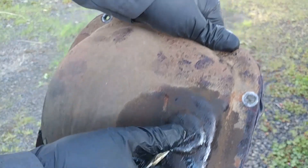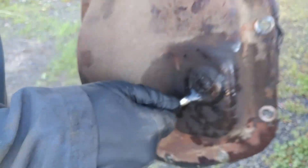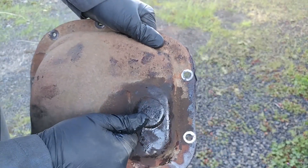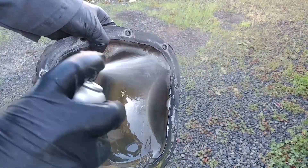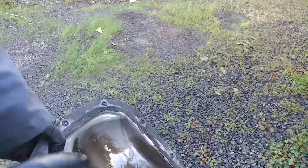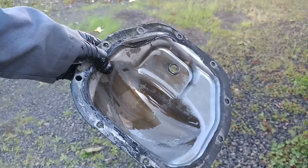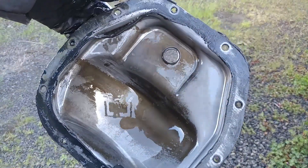It's easier to pull the fill plug before removing the differential cover, but of course I forgot to do that too. You can still do it later — all you need is a flathead screwdriver. With the plug removed, I cleaned off most of the oil using brake cleaner in a well-ventilated area. This fluid looked very dirty. In the future, I will plan to replace it every 2-3 years or 10,000 miles instead.